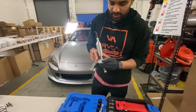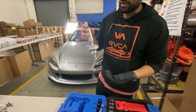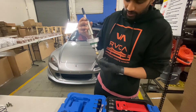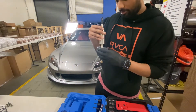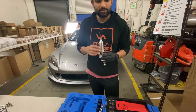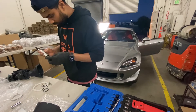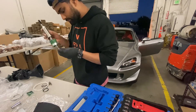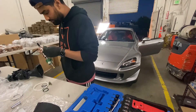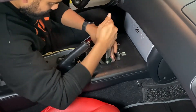Once you get the OEM one out, you essentially just assemble this according to Renegade's directions, which I'll be linking in the description below. You grease the hell out of this with the grease that they provide — basically grease anything that could be a contact point: anything in between the aluminum seat and the ball joint, and then obviously the bushing down here. Then you pop it back in the car, hand-tighten it up, and torque it down — I believe it was 7.2 foot-pounds. I noticed that Renegade gives you just enough grease to cover the entire shifter, which was a little close for comfort for me. If you're like me, you might want to keep a little extra grease on hand before you start this install so you can make sure everything is lathered up well — you don't really want to pop this thing off in a year or two to re-grease it.